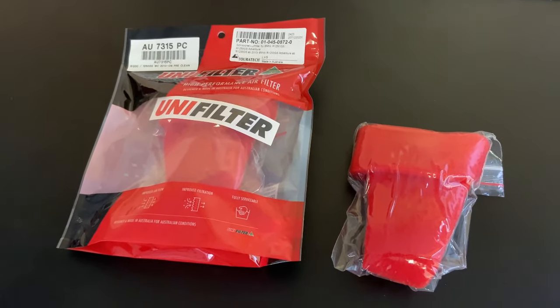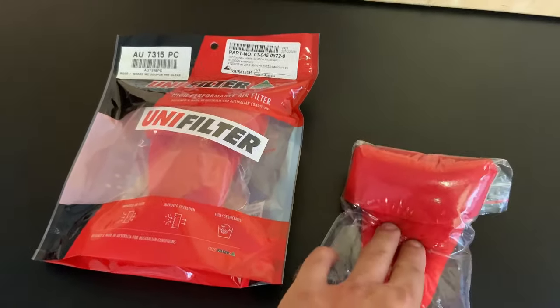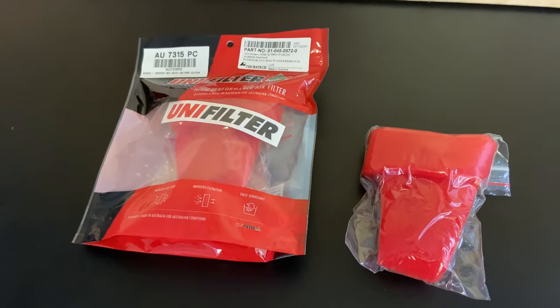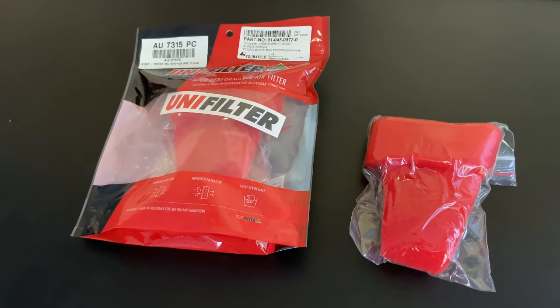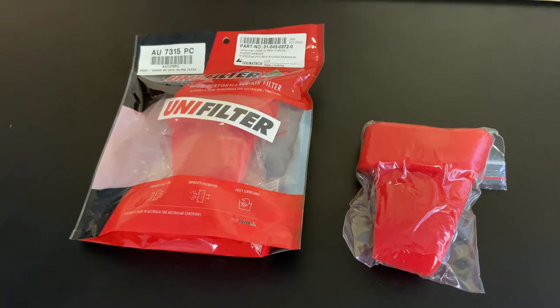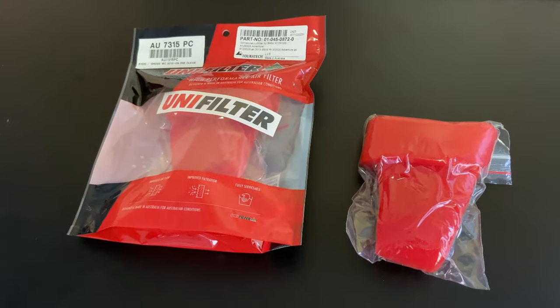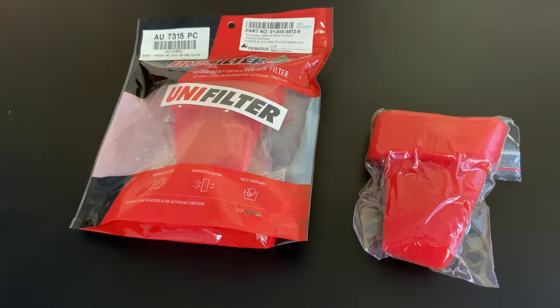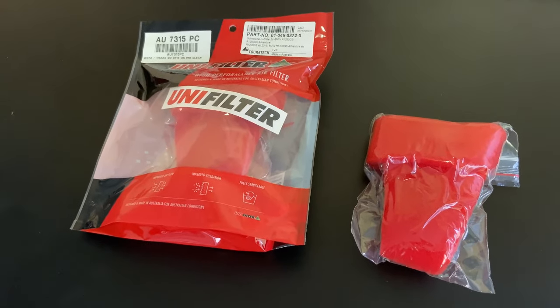Now this is an Australian product, and basically it's like a cone, and this is foam, and you soak it with special filter oil, foam filter oil. It's the kind of filter oil you would use in a dirt bike or an enduro bike. The guys on the Dakar use it. Basically, you can wash this out every 5,000 Ks. You could do it every single ride if you wanted to, but you wash it out with some mineral turpentine